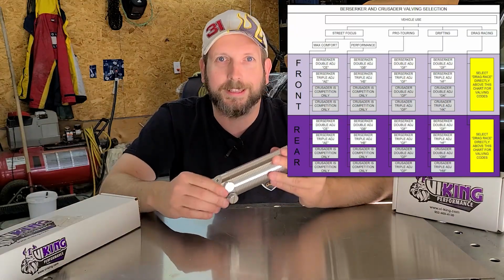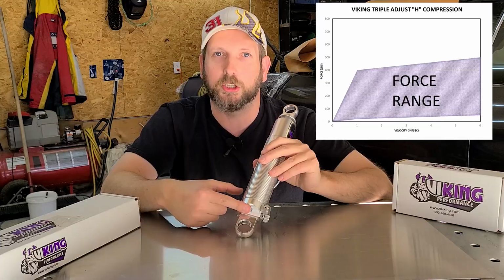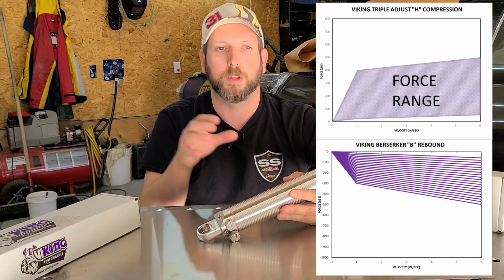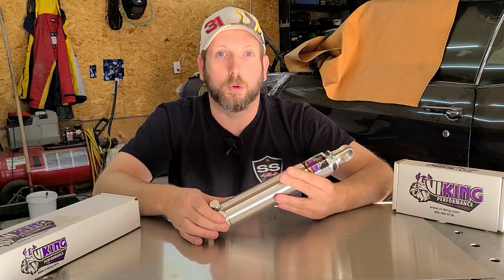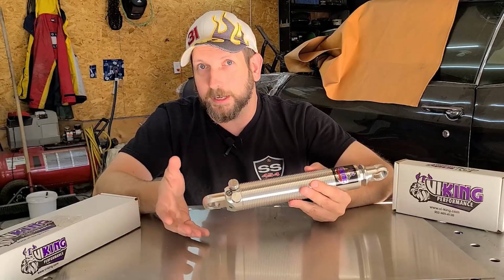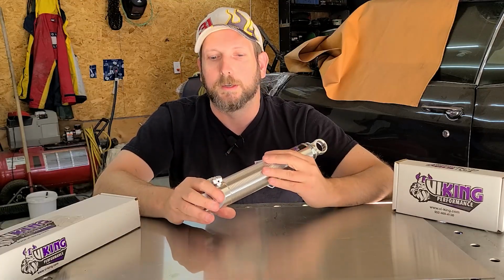For the valving, these can be selected to your choice. I went with the H on the compression and B on the rebound. And that should give me a nice compromise between street driving, road course driving, and drag racing. And honestly, I didn't know what to select, so all I did was call them up, told them what I was going to do with my car, and that is what they recommended. If I find that I don't like it, I can send these back and have them revalved, which is very, very nice.